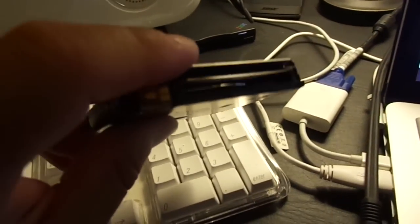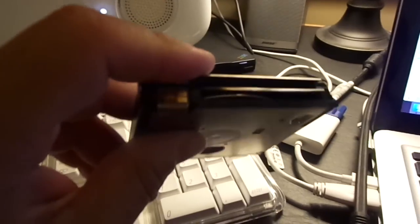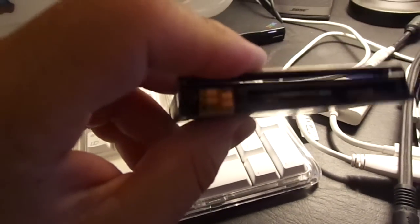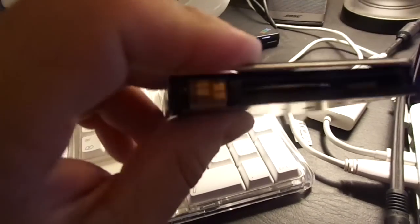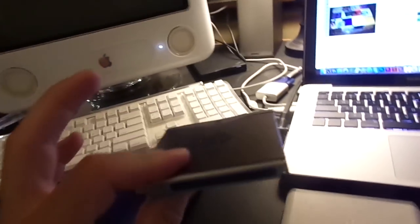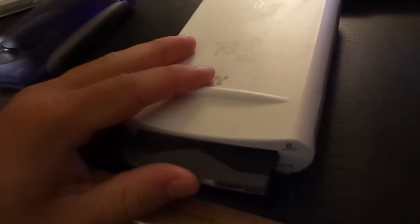Now this drive is obviously no good. It's been dropped a few times, but there's a glass platter in there. I believe it's glass, and you can see it on camera, and you can see the 4-pin header or a connector pad for the spindle motor electrical supply. These were a little more reliable, but again, they wore out because obviously when you load and unload the heads on these things, it's just not good. So as the disk is inserted into the drive, the shutter would be opened, and then the head assembly would carry its way into the cartridge and do its thing.